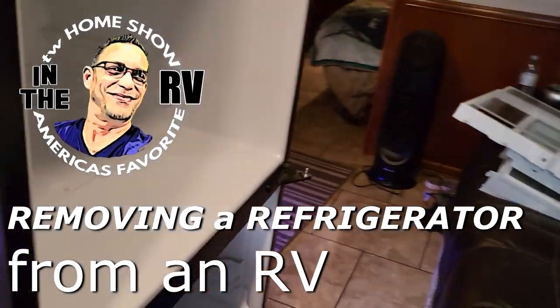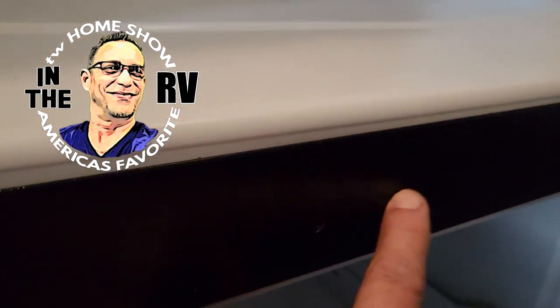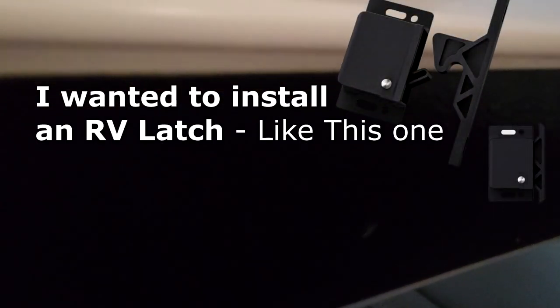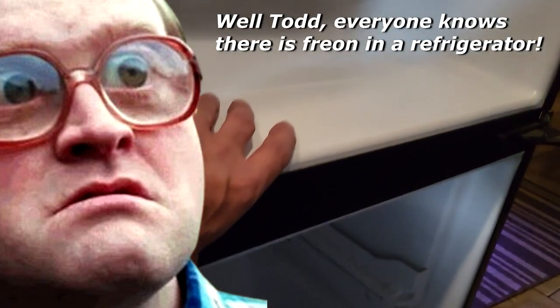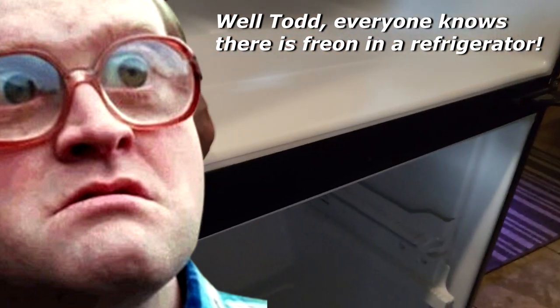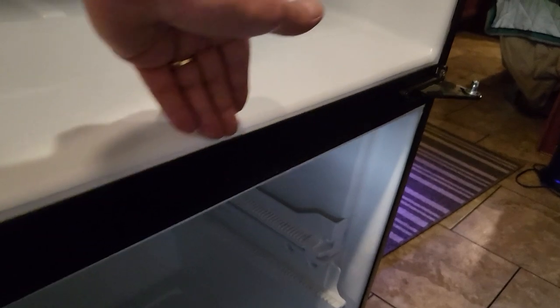All because I tried to put a drawer catch here, I drilled a little pilot hole — only went in about a quarter inch — and then freon blew out of that hole. I hit coils in there. Who would have known coils were sandwiched in between here, right up close to this frame where there are supporting bolts, there's a freon coil right up next to this front frame. So guys, don't do that — don't screw brackets or catches into your refrigerator.